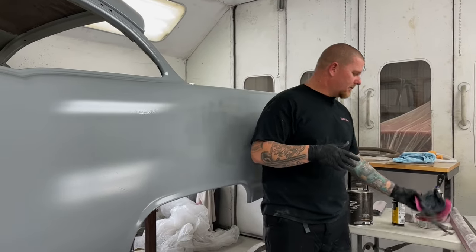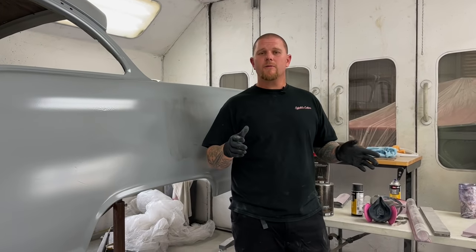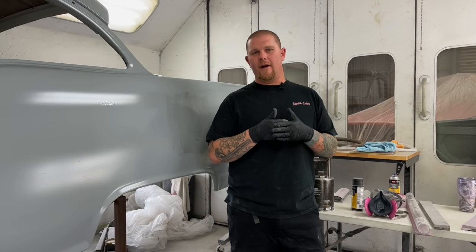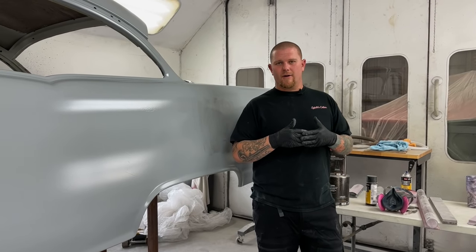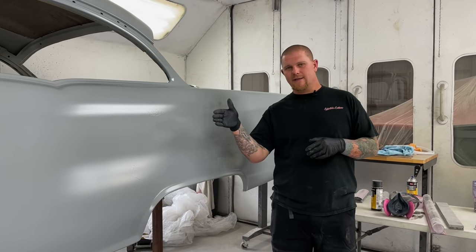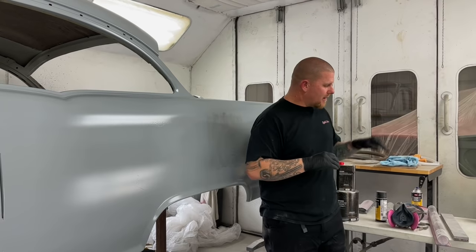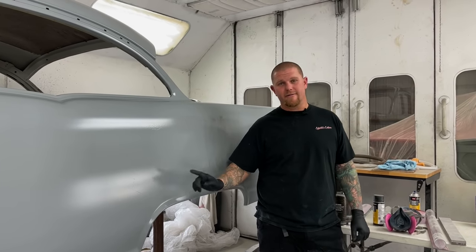When it comes to picking the block, what are we looking for and why? First thing is you always want to be using — especially for a mirror finish — stick-it, meaning sticky-back sandpaper on an acrylic or polycarbonate block, not a velcro or hook-it. Those two will leave you with inconsistencies and ripples in your finish. We're talking microns of differences as you're blocking. Picking that block and using a stick-it is super crucial to what you're going to get on the end finish.